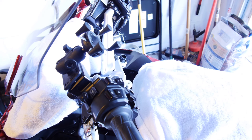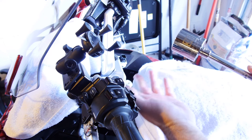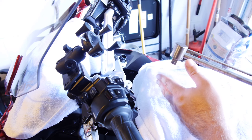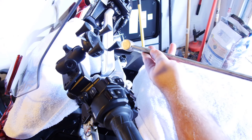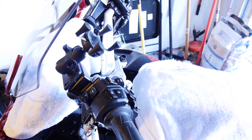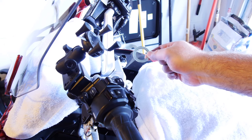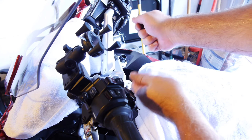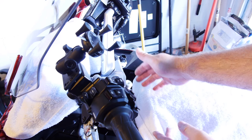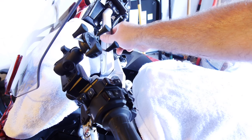The center nut comes off with a 36mm socket. You're going to need a breaker bar just to start it loose — you can use an old torque wrench as a breaker bar — and then it basically just spins off by hand. Take off the washer right underneath it and then gently wiggle the top plate and handlebars straight up off the forks and off the steering stem.